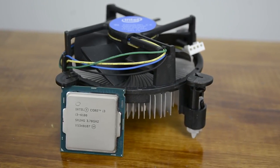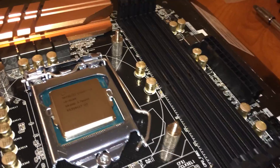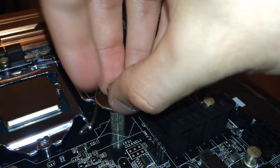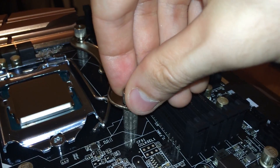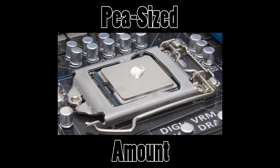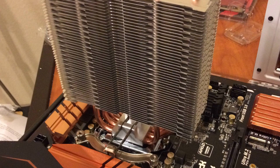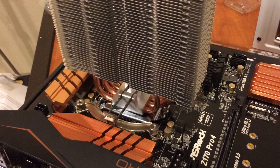Follow the instructions that came with the cooler corresponding to the LGA Socket 1151 motherboard layout, which is the layout of the ASRock board we have here. Make sure nothing is too tight or too loose — things should screw on nice and snug, but don't force anything. Grab some thermal paste, in our case Arctic Silver 5 high density silver paste, and dab a pea-sized amount on top of the CPU. Place the cooler on next using the hinge that came with the accessory. There should be a firm snap into place when rotating the black lever.